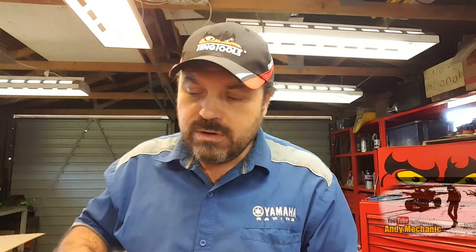I'm going to take you across to the laptop, fire up the screen capture software first, and then we'll launch the PicoScope and test the first new fan. The first fan — the brand new one — is still in its cowl, and it's very important we test all fans in their cowls because it will make a difference on the load on the motor. We'll see what kind of amperage draw it has, and if that fluctuates too much between the segments on the armature — the actual windings.